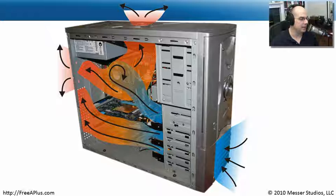There are sections on the back where the air flows out. If there are slots in place for adapter cards you're not using, you don't want to leave those open — it may disrupt the flow of air through your computer. Make sure the flow of air is unobstructed, flowing through with nothing in the way between the front and back of the computer, able to flow properly across all of those very hot components.